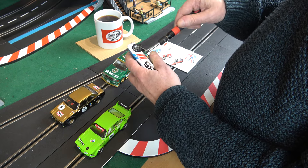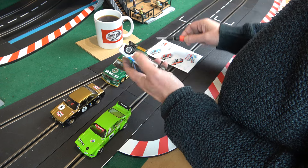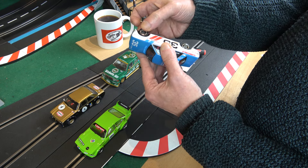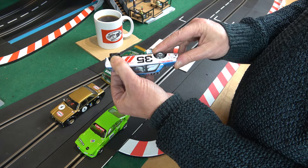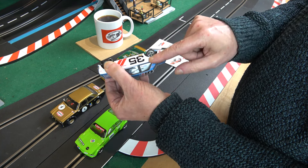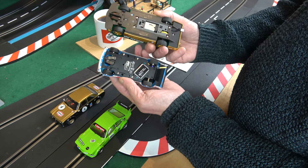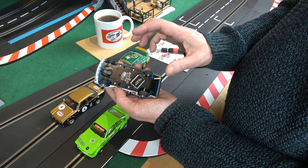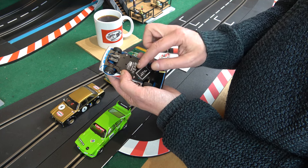Let me accentuate this issue so you can see it on camera. If I undo these a lot, you can really see what's going on. When these are loose, the front of the car moves up and down a lot — it can move that much upwards — and then the back can't move because it's already jammed against the wheel arches.